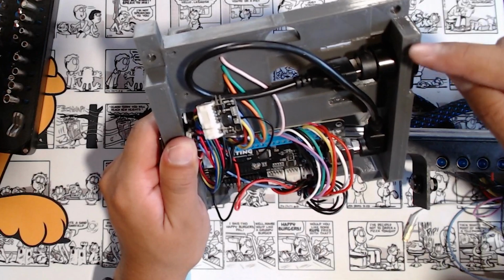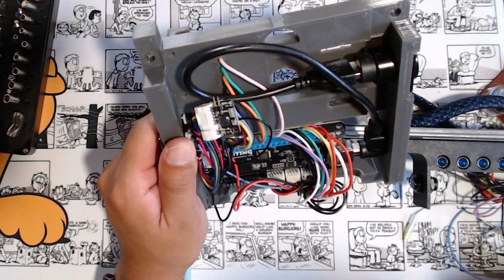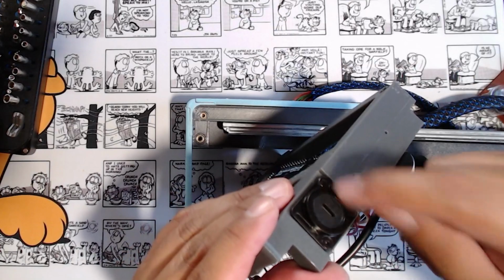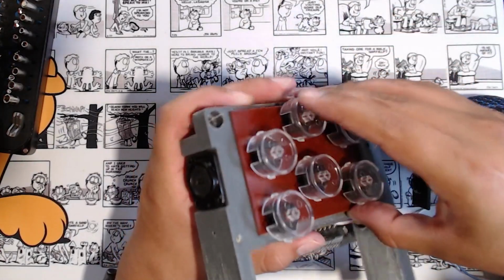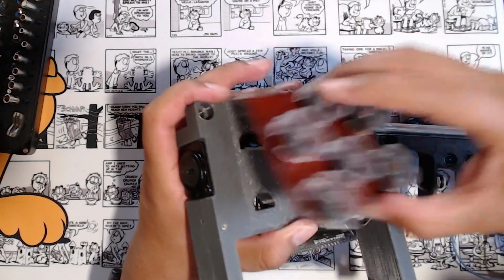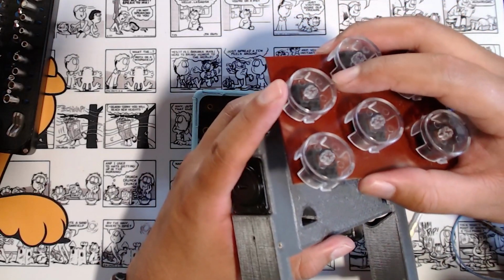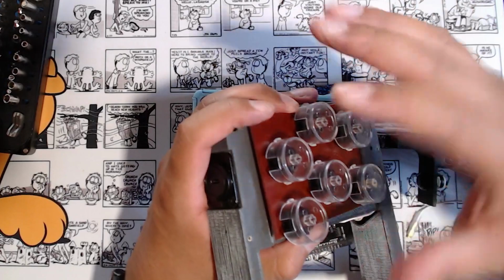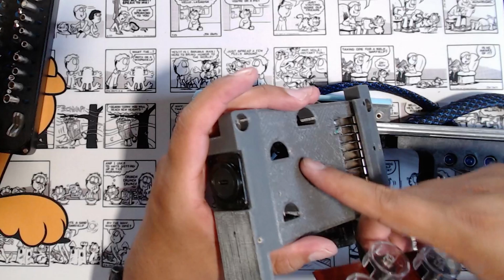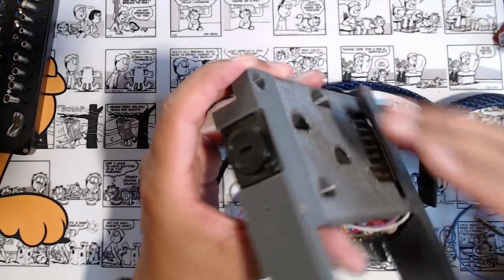The inserts that are inserted into the 3D print here, I think this whole wall needed to be as thick as those brass inserts, because that's also held in right here by some screws. And this piece needed to have so much pressure pushing down on it to make sure it doesn't move. But also, if I push these buttons down, this whole board might kind of flex a little bit. And if it flexed too much, the buttons wouldn't be able to come up again because the acrylic top half might catch it and rub against it, and the buttons would get kind of stuck. So I had to make this piece right here thicker so it can support some of that pressure.